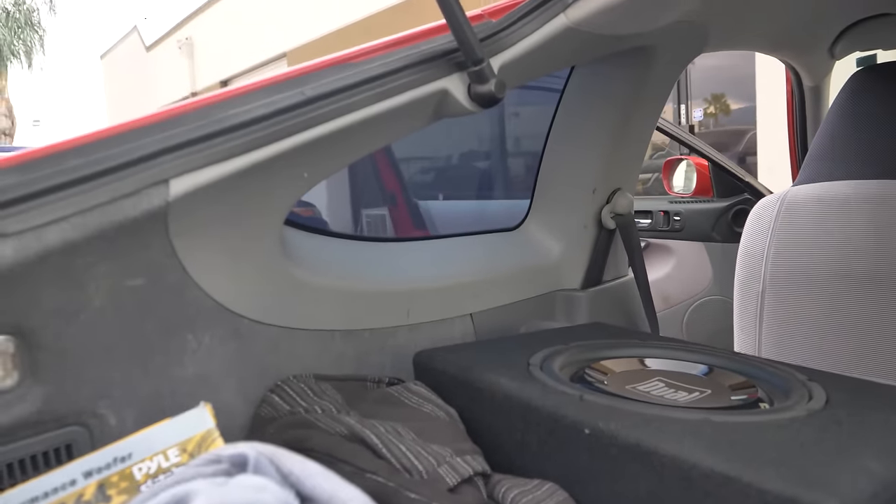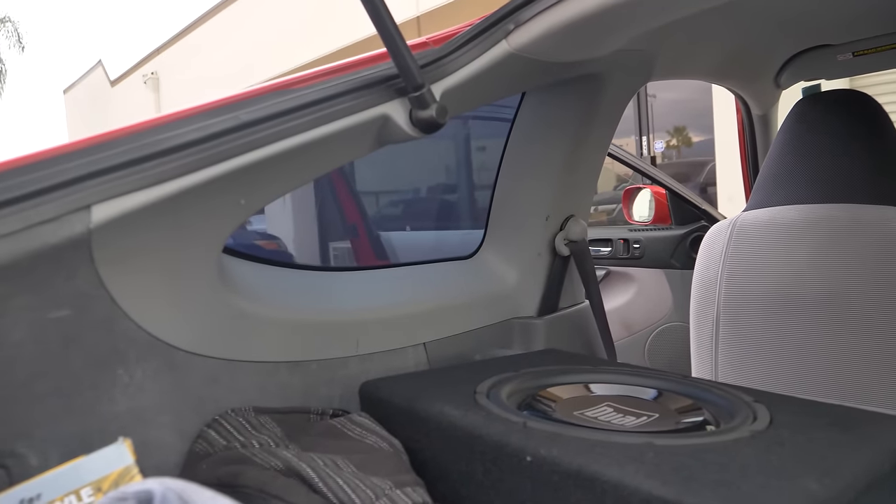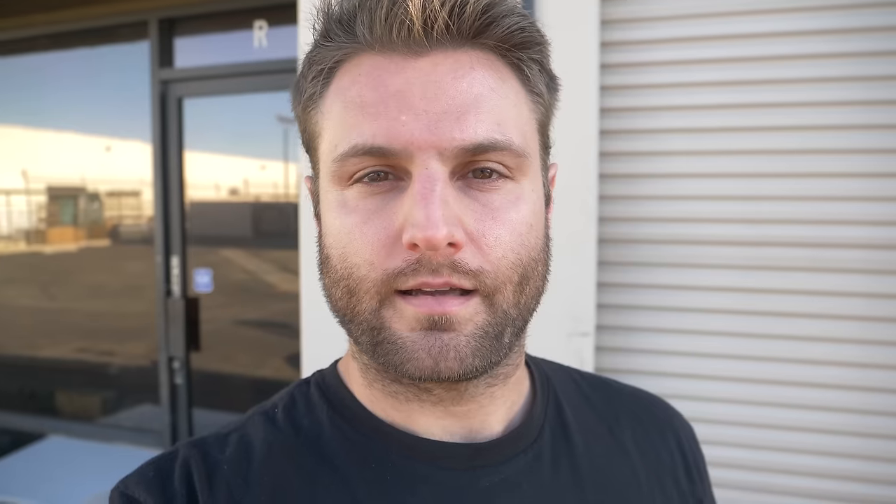First impression is that it is not passable to me. I did contaminate it, but that's also because it's really difficult to work with to be absolutely perfect. Worst yet, because it has no adhesive, it keeps coming back up so you can't lock it in. You can't lock the air bubbles out. You can't lock anything other than sunlight out of the car. That is not even remotely usable or passable as a good tint job. Of course, it does block heat and UV rays, so in the most vague sense of the definition of tint, it is doing its job. There might be one last saving grace — I went out and bought the cheapest hairdryer possible, and I want to see if it can heat up and melt those little fingers on the side of the tint to flatten and contour the surface any better. That's what you do with normal tint — let's see if it works on static cling.